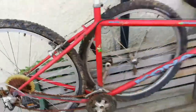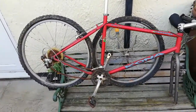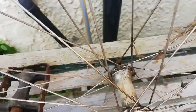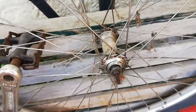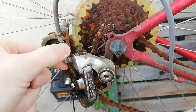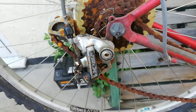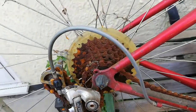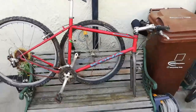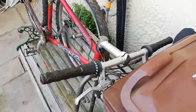So I'm going to fix it up a bit. It doesn't look like there's too much wrong with it — it just needs a good clean. The front skewer is missing the end and the lever is missing on the other side, and it's seized in, so I might have to change that axle. And this is broken here — snapped off — so I'll have to try and drill that out and change it. New chain, the cassette will clean up I think and go again. Just going to give it a good clean up and get it working again.